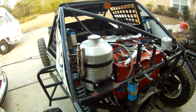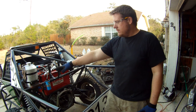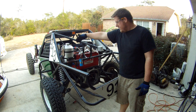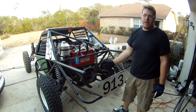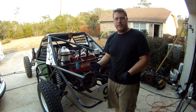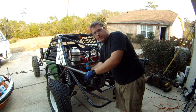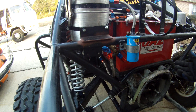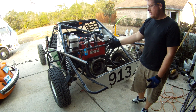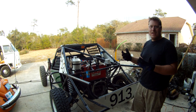On this oil system, it's a little bit unusual because most of the time you'd have a dry sump that's level with the motor. You want to make sure the dry sump can doesn't get too much higher than the oil sump on your motor — otherwise you have a feed problem with a lot of oil sitting up high. Eventually it'll drain back into the case and fill the motor up quick. If you're going to mount a can up high, you can either put a shutoff valve in line with the front of the oil pump, or on this can I put a shutoff valve on the outside of the oil catch can. You can turn it on and off — but this is a little dangerous because if you forget to turn it on and start the motor, you can cook it. So you've got to make sure that's part of your startup procedure.